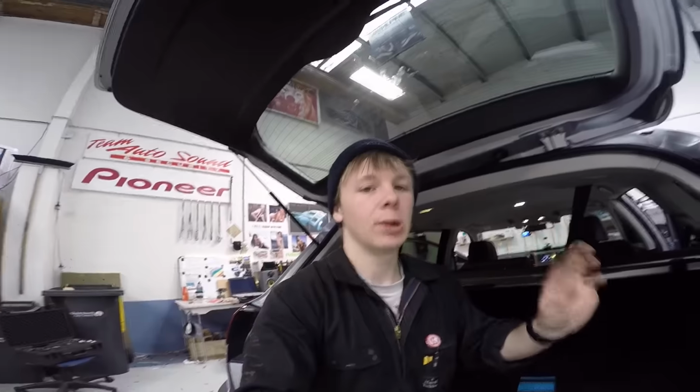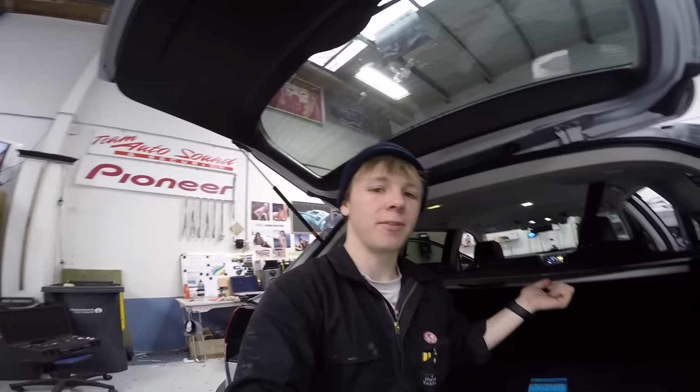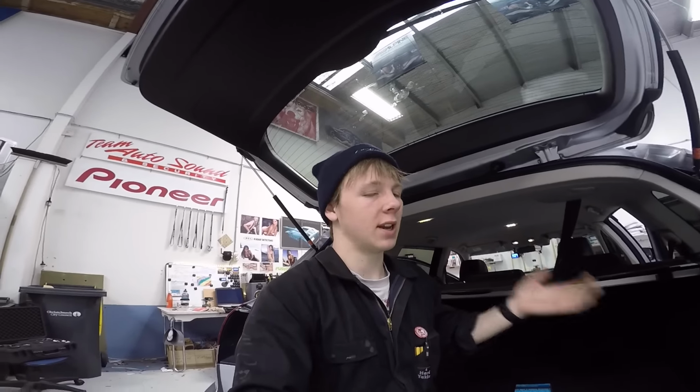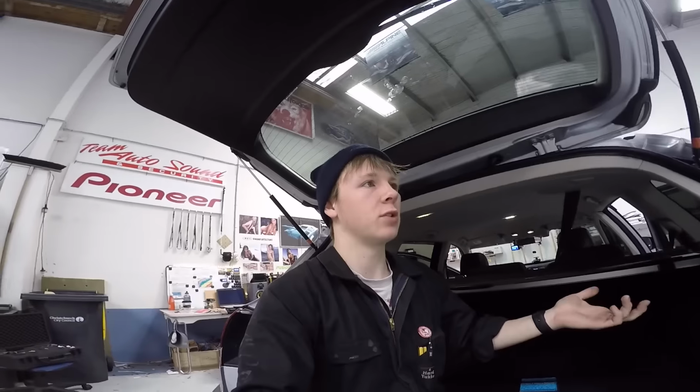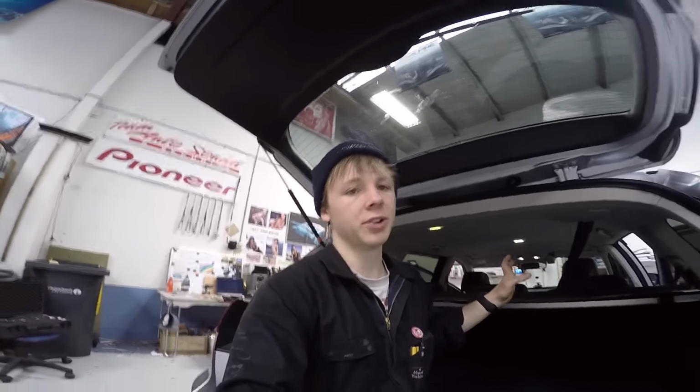I said earlier that I could probably tune it today, which I realised I actually can't, because I still have all the factory speakers connected to the output of the head unit. If I could turn the internal amplifier on the head unit off, then I could tune it. But since I can't, then I pretty much can't. I have to wait till I've got all those factory speakers disconnected from the internal amplifier of the head unit